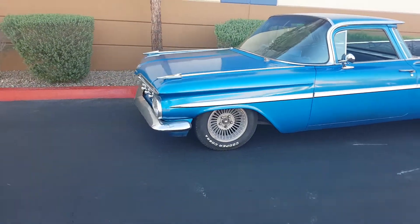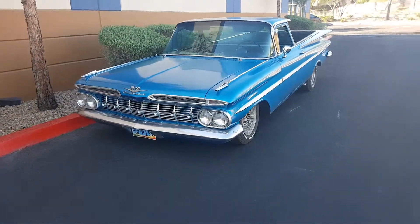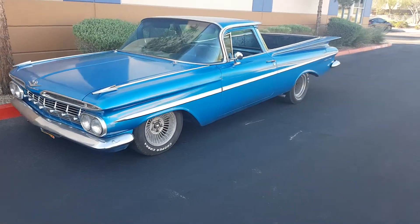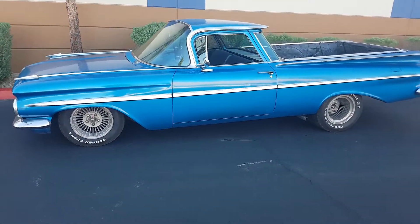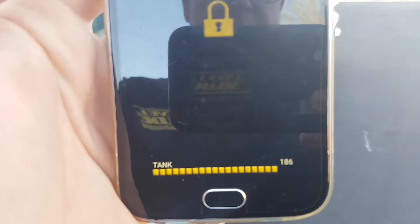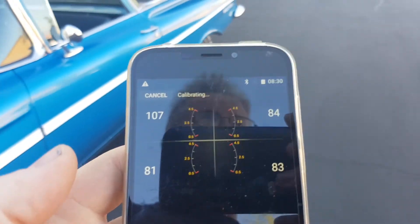While we're doing that, we'll go through some of the other stuff happening in the calibration. You've always got to make sure that you're on reasonably flat ground. The reason being is that in a pressure-only system, corner load is more important. Corner load refers to things like sitting on a bump or uneven ground, and that will drastically affect the calibration because what it's looking for is trying to get your pressures fairly even all the way around.